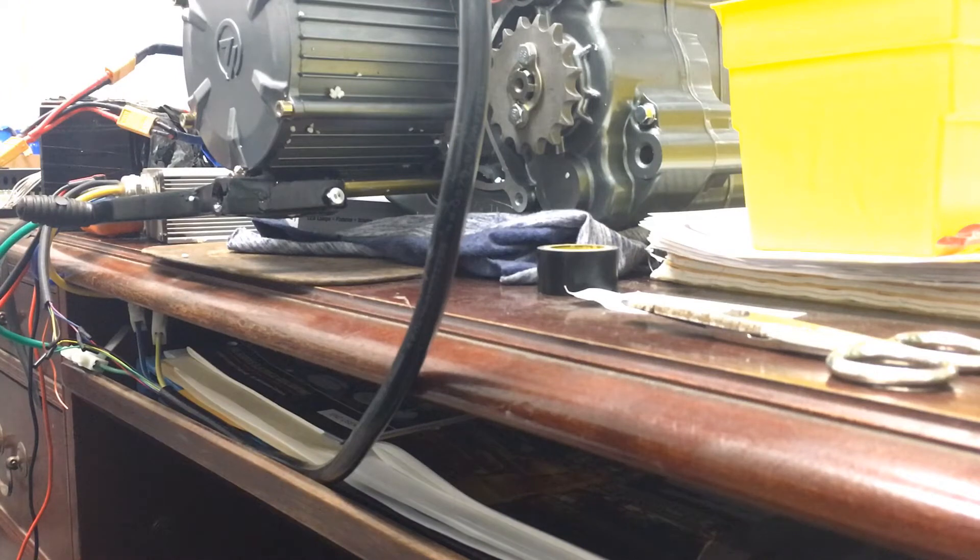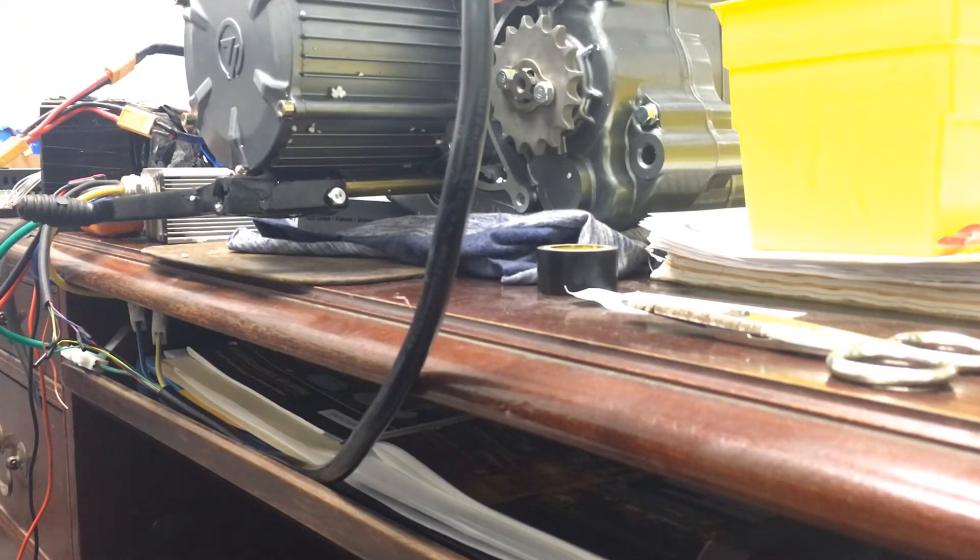It's got the KLS bucking problem. It looks like this motor cannot be used with sine wave. This KLS is out — I'm going to have to use a KBS. You can already notice the bucking; it's probably going to skew the test too.